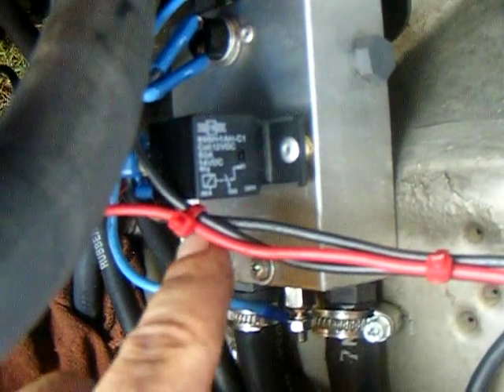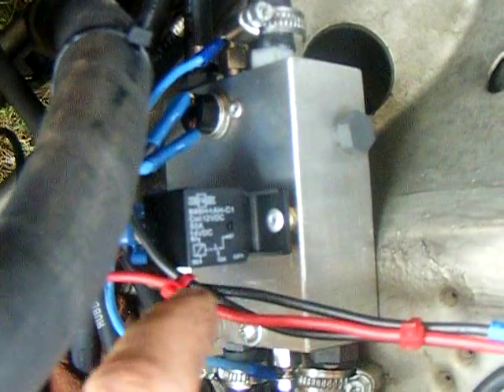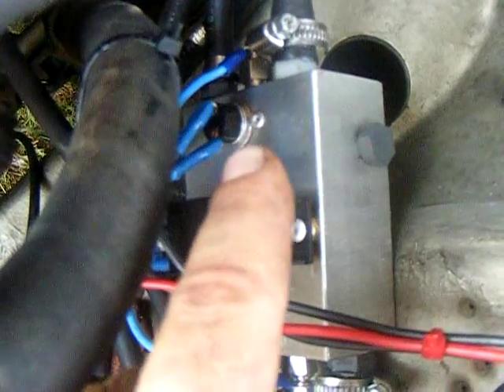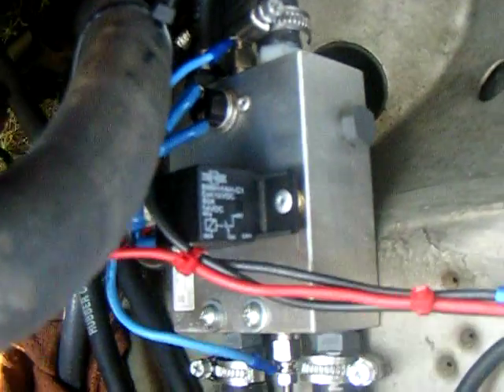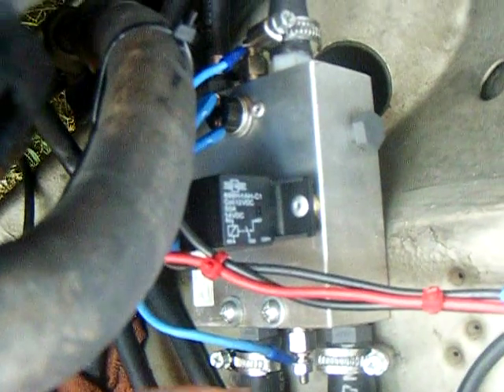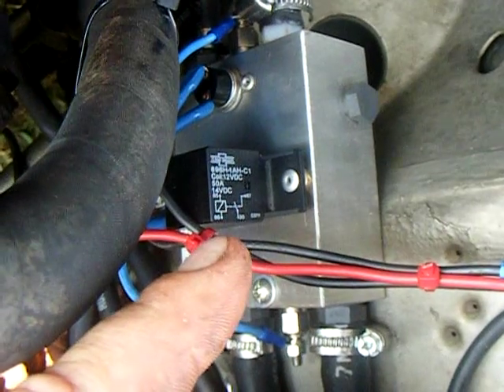This is an aluminum block preheater. It has water-in and water-out connections, so it's an inside loop. The block is heated by hot water from the motor. It has a relay, a temperature switch, and two glow blocks on each side. Inside the car I have a switch that I can turn on this glow box before the water is actually hot — it will preheat all the blocks in about 30 seconds.